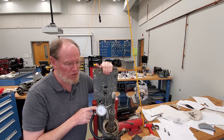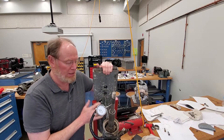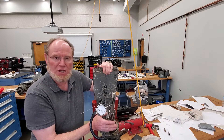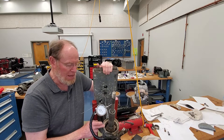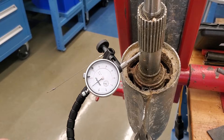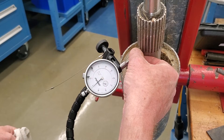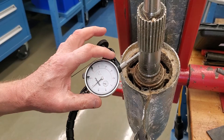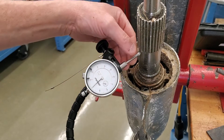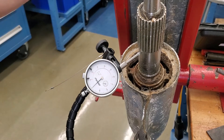I hope this gives you a quick idea of how to check propeller shaft runout with a dial indicator. The tube shaft here, which is the outer prop shaft, has the aft gear welded to it. I've got the dial indicator set up here in the prop shaft and we'll make sure it's pretty centered. Dial it into zero — make sure it's zeroed — yep, right on the money.